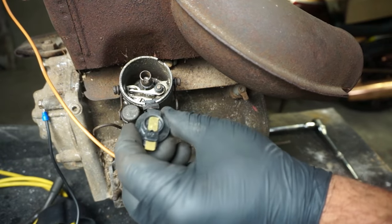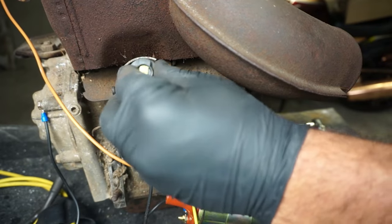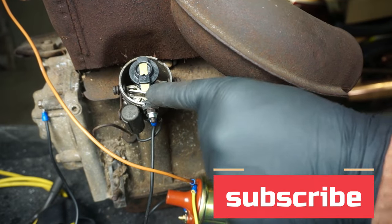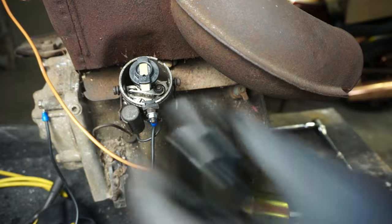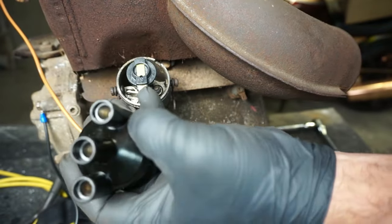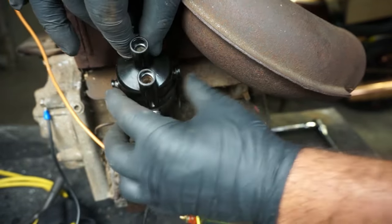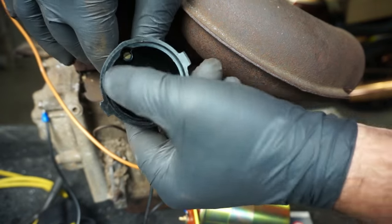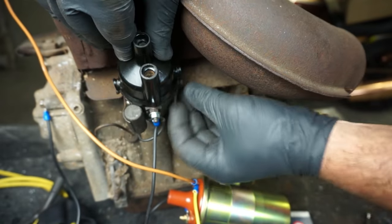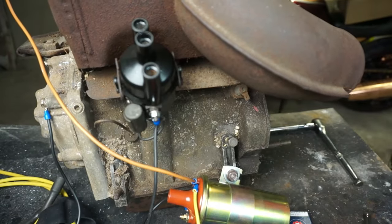Now we're gonna put the rotor on the distributor. Okay, this thing facing downwards, which means it's gonna be fired on first cylinder. Now we're gonna put the distributor cap. It's numbers 1 and 2. Number 1 is going obviously down. We also got some pin which is going straight in place. I click it by the special springs, and now we got this attached.